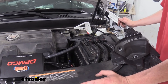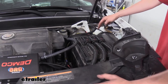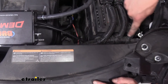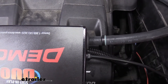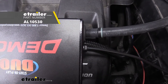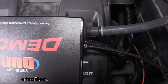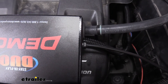That completes connecting all the wiring. Now let's move on to getting our airline connected. The black line connected to the cylinder inside we routed down next to the fuse box, wrapped around the battery underneath the factory wiring, and it goes right over to the unit — we just push it into the quick connect. When trimming your hose, make sure you use hose cutters to get a nice clean square cut so it will seal properly. Using side cutters usually deforms the hose and causes leaks at the quick connect.